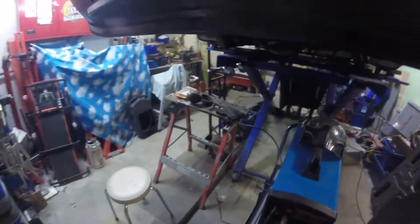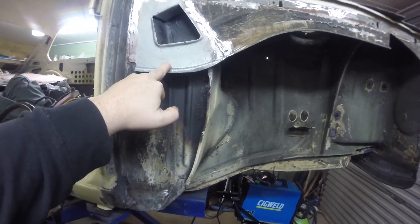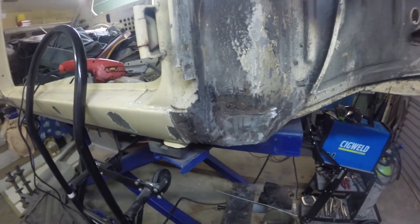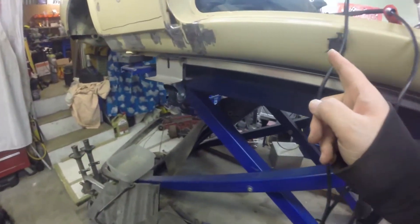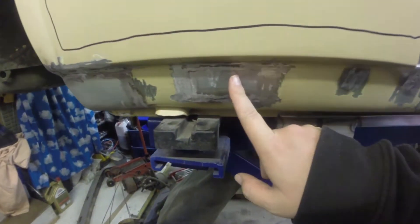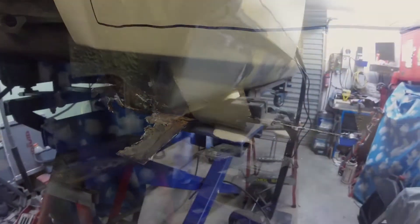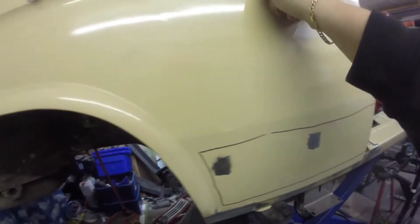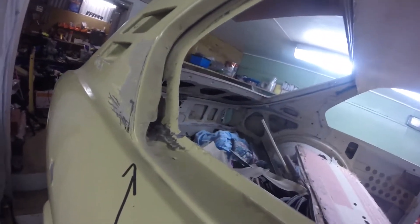Going around to the other side and starting from the front: same situation on this side - new outer guard support and we repaired the inside of the inner guard. Moving down again, another piece on the A-pillar at the same spot - looks like there are a few common areas where these things rot. Again the holes are welded up for where the trim goes, and a bit of nastiness around here has been tidied up. There's a whole new plate where there was rot, and you saw in the last video where I pulled the nasty bit of metal down - that's the new handmade piece that went in, and it's bloody good. Holes along the side are all done.